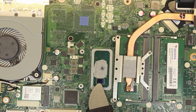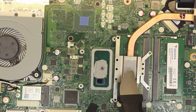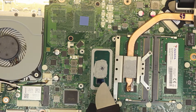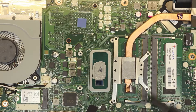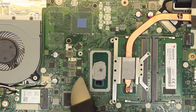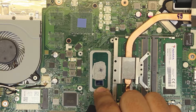There's not much we can do here. We can add a thermal pad to try to help bridge the gap so it actually touches the heat sink, but a thermal pad is not the same as thermal paste under pressure, so it will help but not that much. Honestly, don't buy this one — return it. Ideally you'd need a major modification: put a copper shim on top that covers both dies. I'd do that on a personal computer, but since this is a client's machine, we're not going to do any modification.